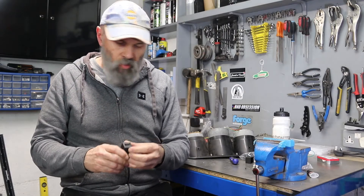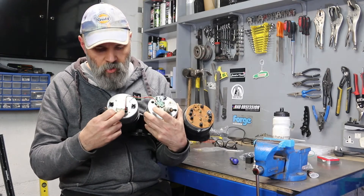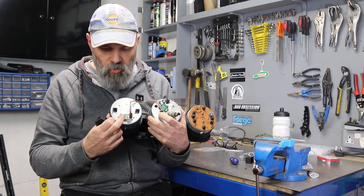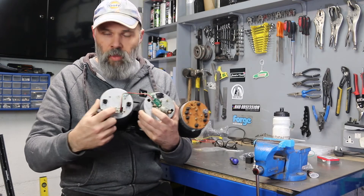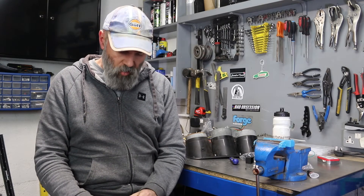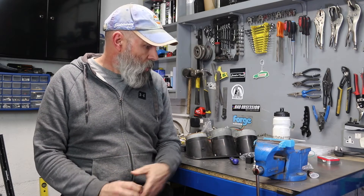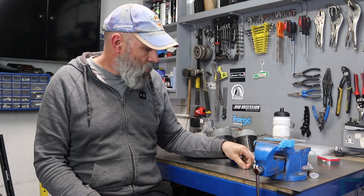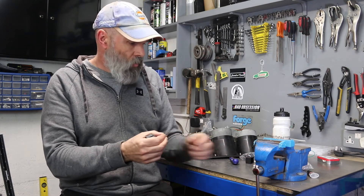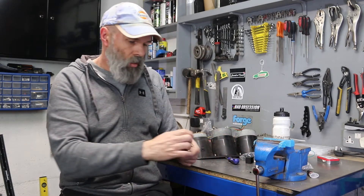That worked, which is obviously good. One thing I would point out is on the back you've got the green connector where the ECU signal goes in, and the middle bottom one — there's a black wire going in there. Somewhere in removing all the engine wires I'd managed to disconnect that signal, so just check that it's still live. If you're doing this conversion, chances are you've somewhere along the line removed that power connection, so just check and make sure that's there.